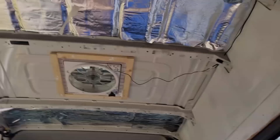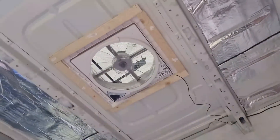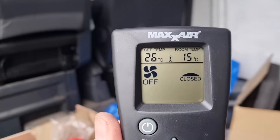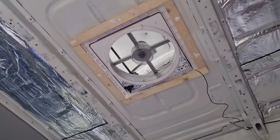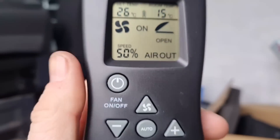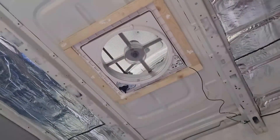Negative into the bus bar, positive down there - the light's on because there is no fuse. As soon as I put the fuse in, it should work. There's your remote control - the temperature is set at 26, so if the fan detects the temperature is higher than 26 it'll automatically come on and circulate the air. Room temperature is currently 15 degrees, it's closed and off - press that - it's opening and it's come on. It's on, open, set to take the air out, set at 50. You can change absolutely all the settings you want.